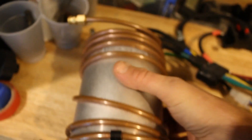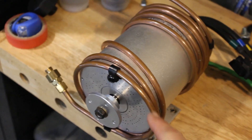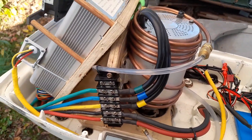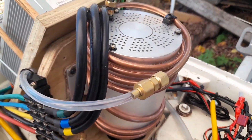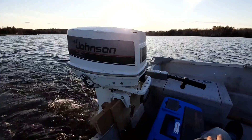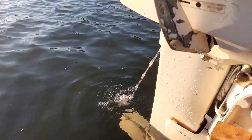While I had it opened up, I also drilled all these holes out on the case. When I bought this motor, it came with little indentations on it but they weren't holes — they were just little dents, only going in halfway through the material. So I went with a drill press and drilled out every single hole to allow some heat to escape. This copper coil you see around it is something I made to attempt to cool the motor. When I ran this in the electric boat, I had a small 12 volt pump pumping water out of the lake into one end, and it would run the water around the motor and spit it out the end — just like a regular outboard gas engine uses water cooling. It seemed to work pretty well.